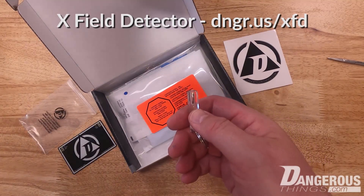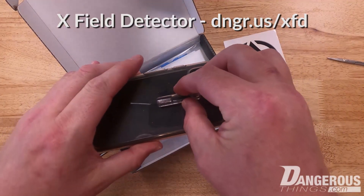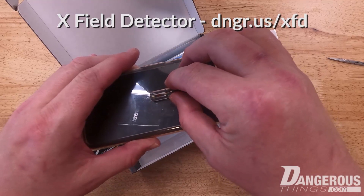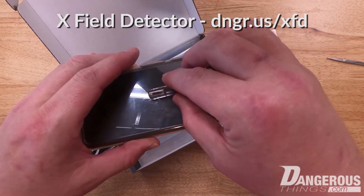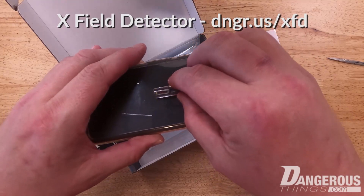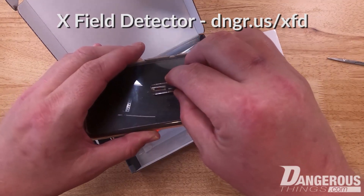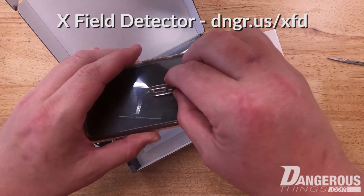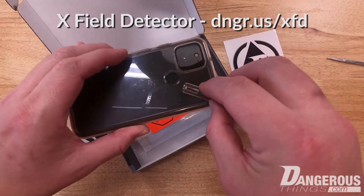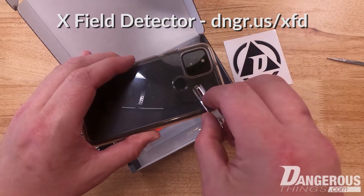On my Pixel 5, we can see that in this orientation and location we get some blinks. The blinking means the duty cycle is really low — it's only checking for tags every once in a while, because this is a battery-powered device. You don't want it kicking out a bunch of power to look for tags all the time.